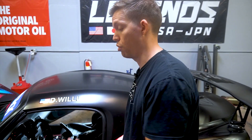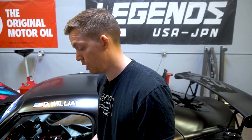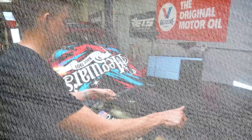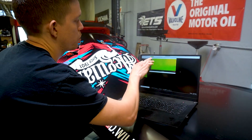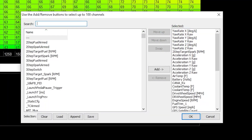As many of you are aware, this car is running the AEM Infinity ECU. To start the data logging process, we need to make sure all the channels are set up in the ECU. We'll flip on ignition power, come up to the ECU, and check out the channel setup and logging setup in the Infinity ECU. We'll start by launching Infinity Tuner, and we have our remote USB going to the ECU. Once connected, you'll see it's green at the top. We'll jump to Logging and then USB Logging Channel Setup. You can log up to 100 channels on the Infinity ECU.